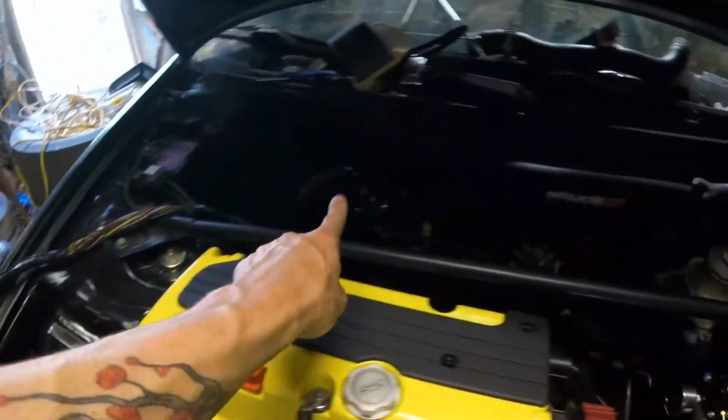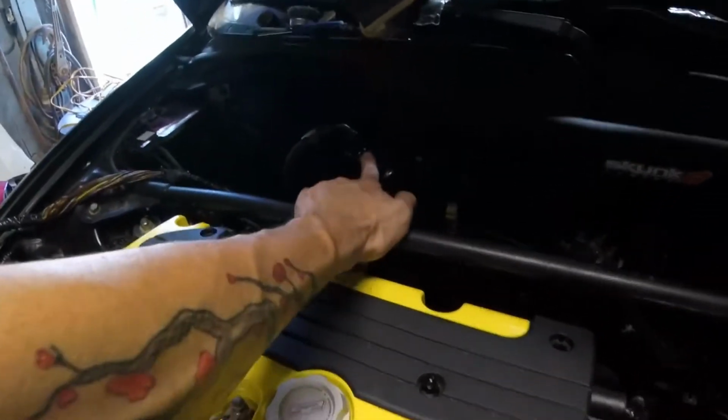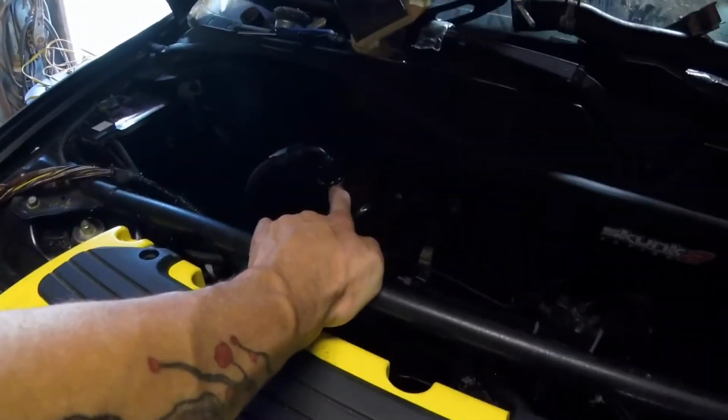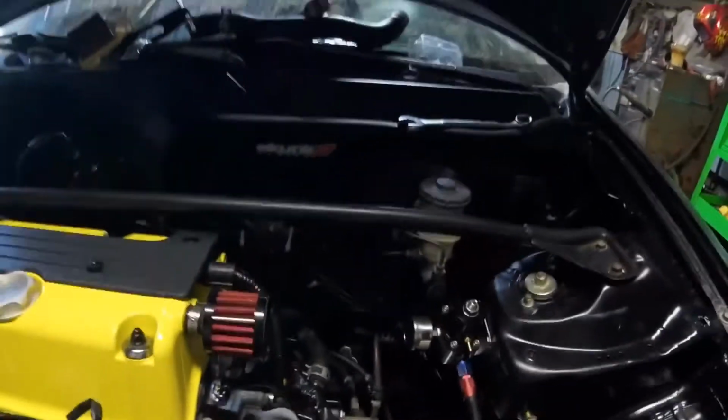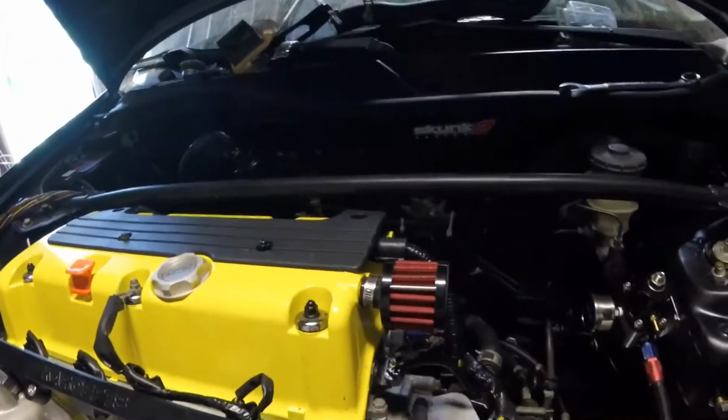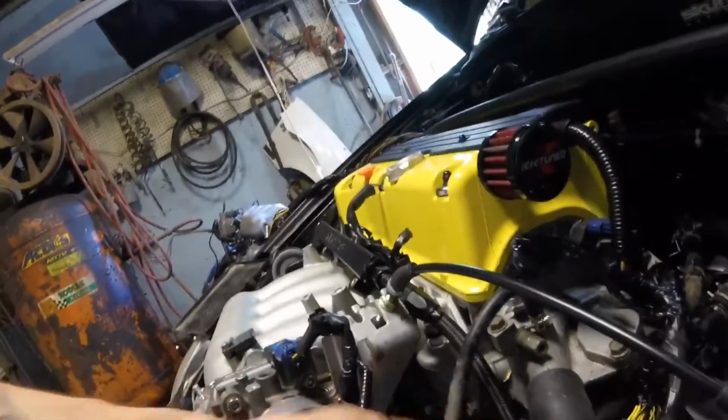And ran fuel lines. So I bought two 45s from Vibrant, a 90. I don't remember what the thread pitch exactly is. I want to say like 12 by 1.25 or something to go in there. And then I didn't have enough hose ends, so I got a straight here. And this is all just 6AN line. Bend it down, runs, not touching the coolant line, not touching my loop, which I need to replace because this hose isn't really coolant approved line.